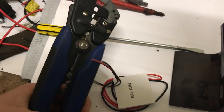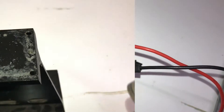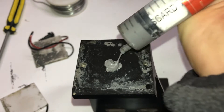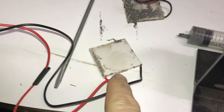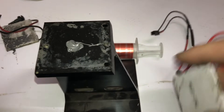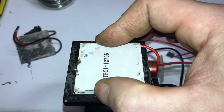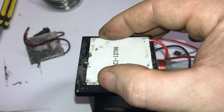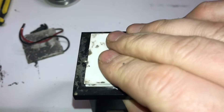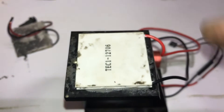With our snips, give it a cut. Now with the wire end soldered, we're going to wrap the heat shrink onto it and then shrink it down. Next, we're going to get the thermal paste and put a nice blob right in the middle. Now we take our new peltier sensor and put it down with the wires pointing towards the back, writing on top, and just set it straight down. Move it around a little bit — make sure not to put loads of tiny ones all over the place, just one in the middle.